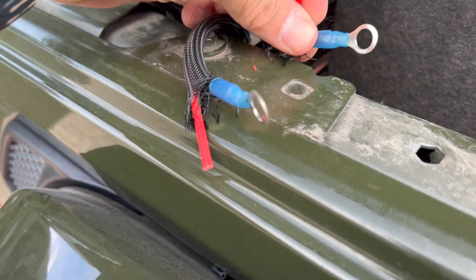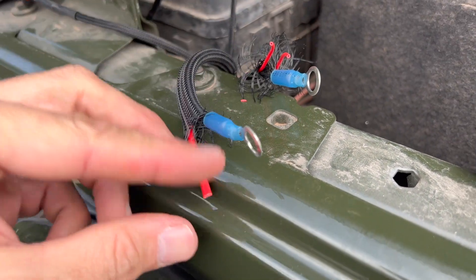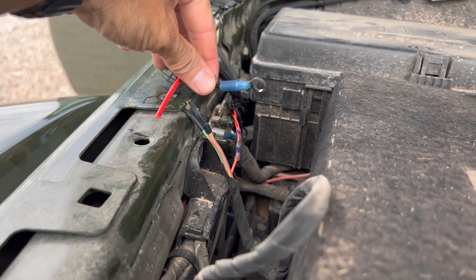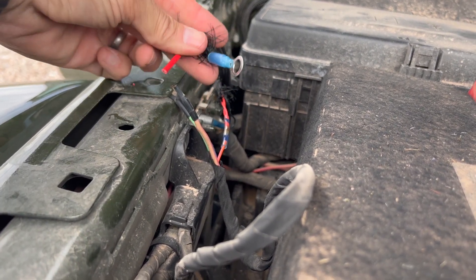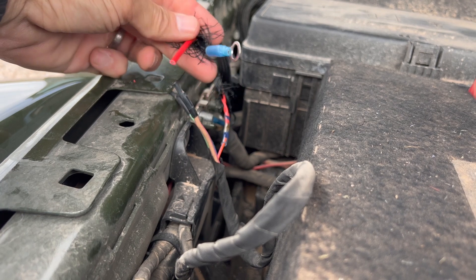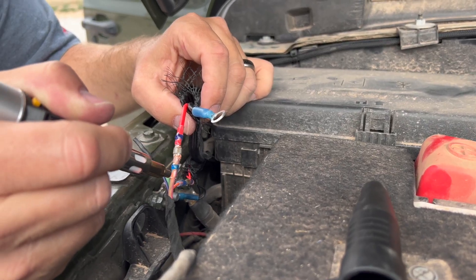We cut the end of the line off with the cube lights and light bar. In each wire you'll have a black and red wire — the black is the ground wire and attaches to your Jeep's frame, and the red is the power wire which gets connected to the aux power wire.